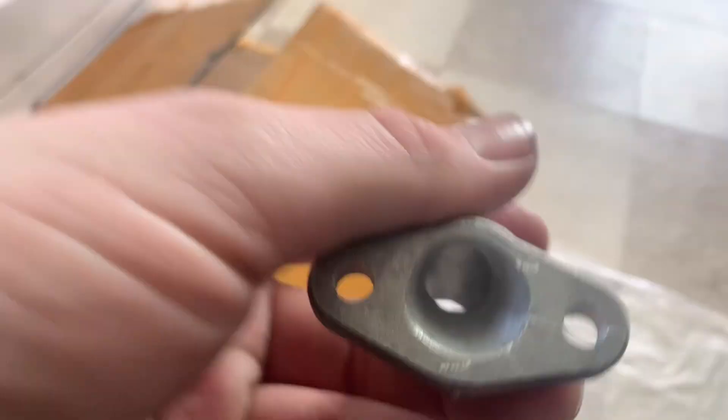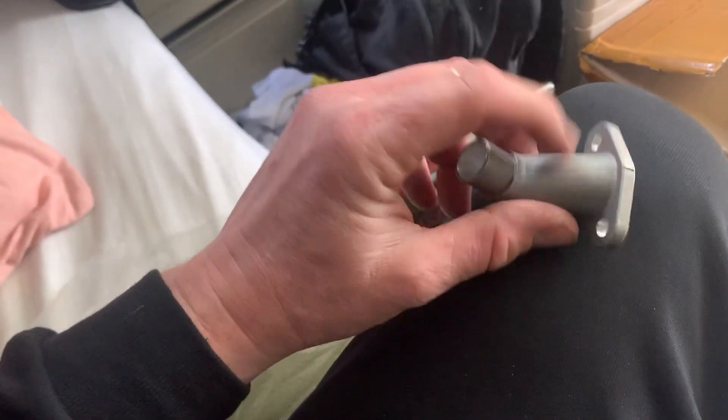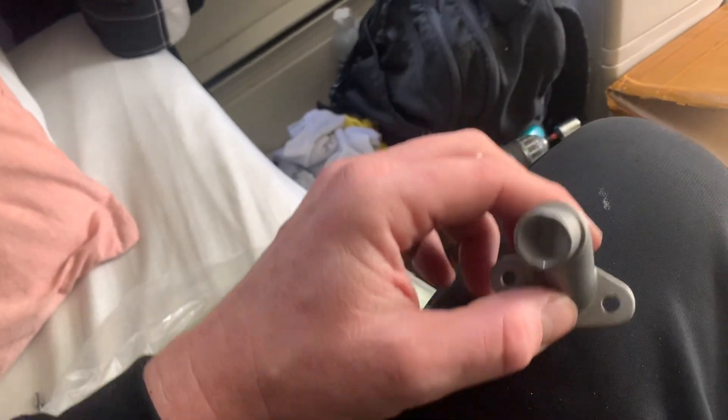I took the intake — I still could take more, but I had one crack right here because I opened it up so much. The whole carburetor fell down with this attached, but the flange was still attached to the intake. That was the original 100 CC intake I had that came with my motor when I first bought it a few months back. So it cracked, that's why I didn't open this up as much as I really wanted to. I just wanted to get something to replace my motor.